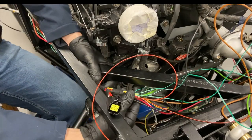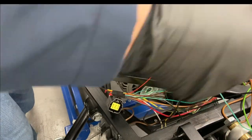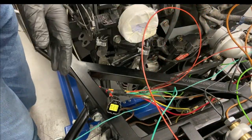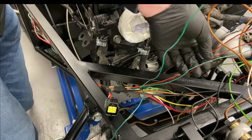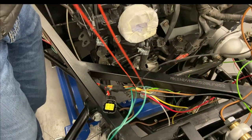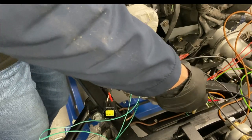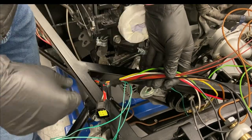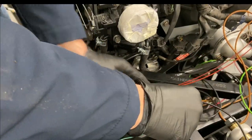There's your output for the headlight on this side - that will come up through there. Now we'll create the indicator. There's a four-block indicator - again that is in the manual with the pin-outs. What I need here is a red-black. I've got two red-blacks in this loom. I need a red-black, I need a red, and two blacks - that's going to go down to my multi-joint. I could theoretically double that up and put that into the socket, but it's a bit harder putting two wires into one of these little plugs.